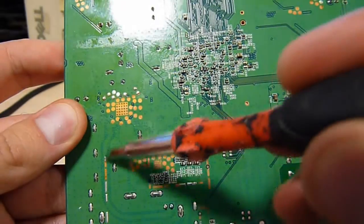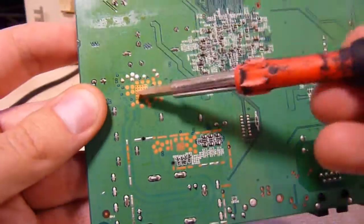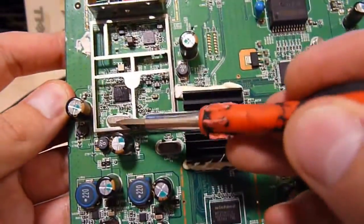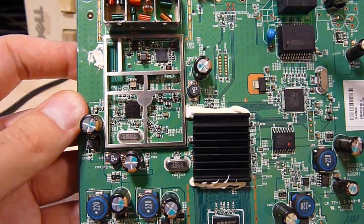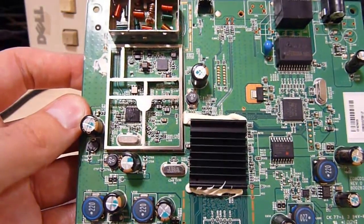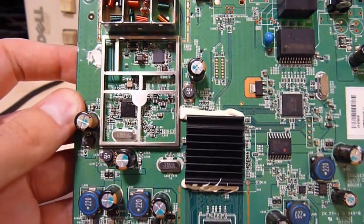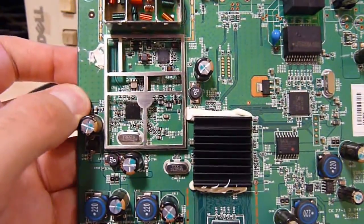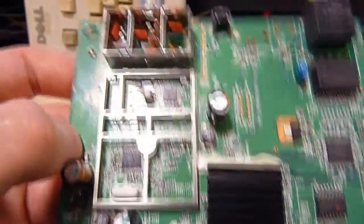We've got various wiring leading to this chip, which receives the signals. And of course we've got the crystal to make sure it's clocked at the right frequency. Although if you're smart on this stuff, you'll make sure it is a Manchester type system, which has the clock included. Correct me if I'm wrong about Manchester code there — we've done a little bit on it at uni, but not a huge amount, so I ain't no expert.